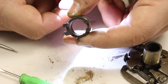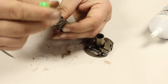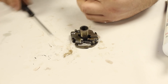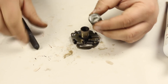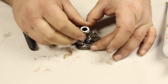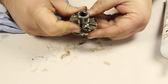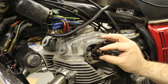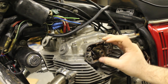White lithium grease is applied on every surface that has moving parts. In the center points cam, make note of the groove on the inside — this is a grease reservoir and should have grease applied in there as well as on the outside feet. Place the cam back on the base plate, making sure to have the alignment mark on the same side as the alignment notch, and finish reassembling the mechanism. Wipe off any excess grease and turn the trigger cam so the weights move outward, then release. The mechanism should move smoothly and freely once reassembled. Place the advance mechanism back on the engine, setting it on the drive pin, but don't install the bolt and washer just yet.